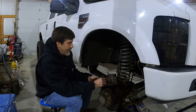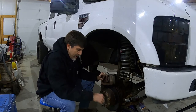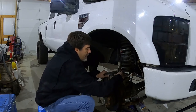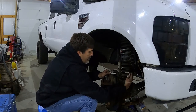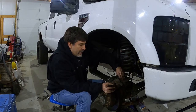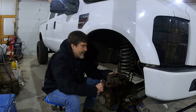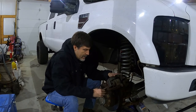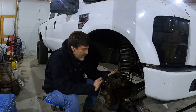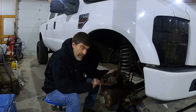When I was a kid holding the flashlight for my dad, he had to use a C-clamp — which is what I'm about to switch to, because this little hand crank on this tool is not really meant for doing a double piston caliper. Let's see if the C-clamp does any better. It feels like one of the calipers is compressing better than the other. One piston isn't moving and the other is moving much easier. I've got one cylinder where the piston goes in pretty easily and one that won't go in at all, so if I can't get that piston moving more freely, I'm going to have to replace this caliper.